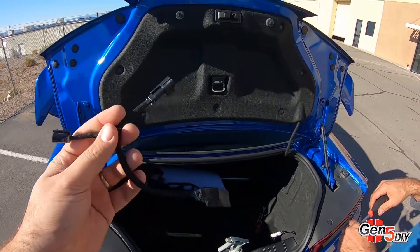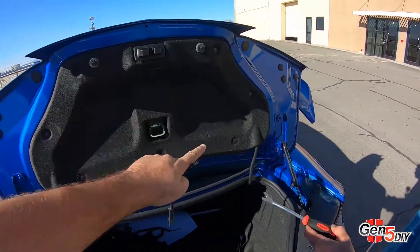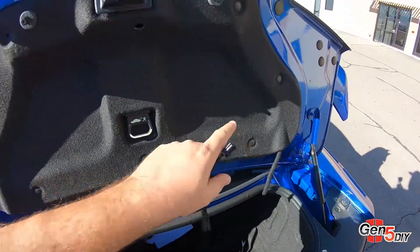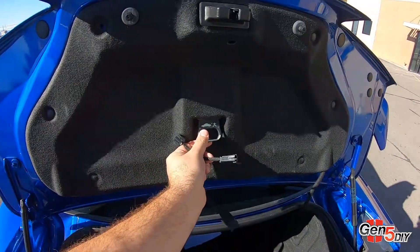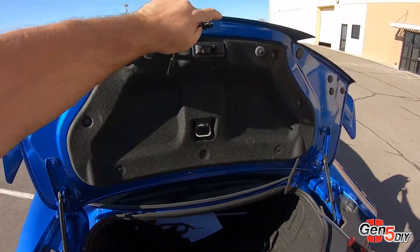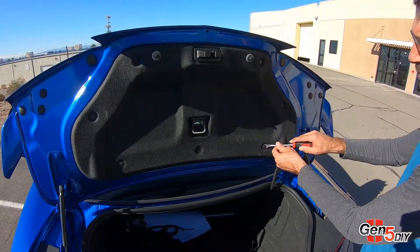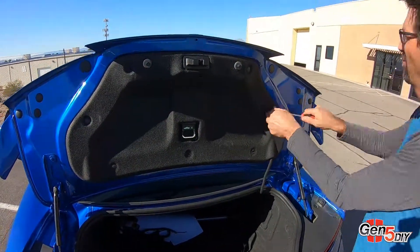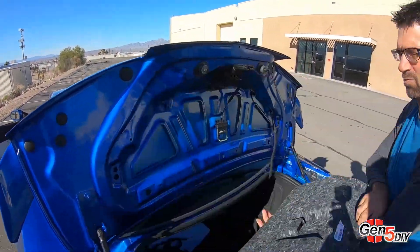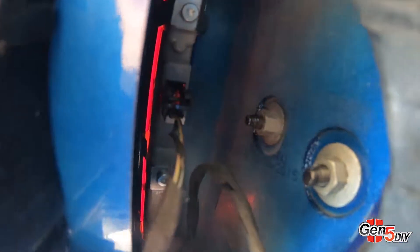For this install it's actually pretty simple. The one thing that probably takes the most time is removing the rear felt cover. There's a couple tree clips that you have to pull, there is a plastic thing that you pop off, and you just feed this through — this is the emergency exit out of the trunk to get to the upper area. Let's go ahead and pull that off. We'll do a little fast motion here. We have the felt cover off now.